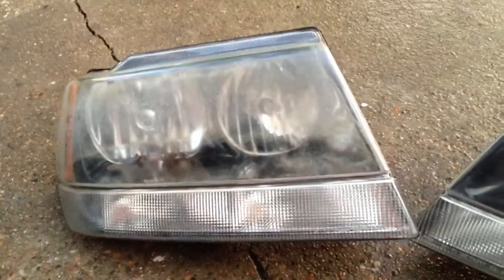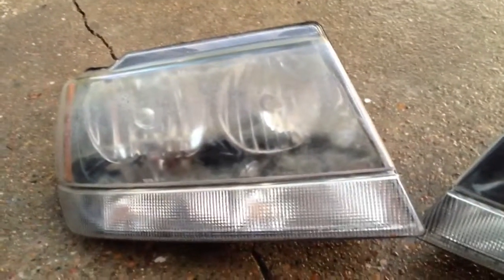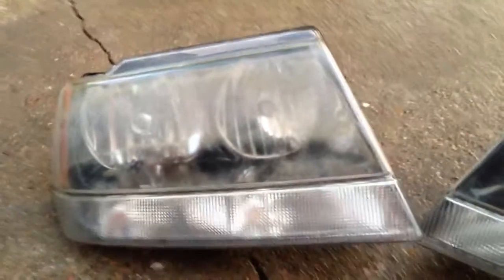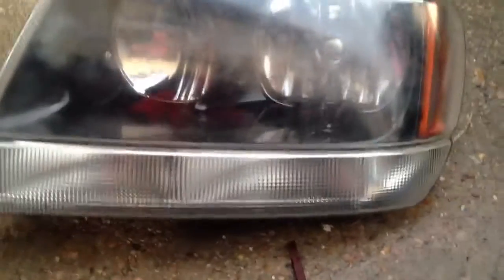I got a couple of them. A friend of mine asked me to clean these lights, and so I went down and cleaned them three or four times — they turned out bad. So I had a set here that I had taken out of another car, and I polished them up with this technique. Just stay with the sanding a bit longer than I did and you'll get all the way down to totally smooth, clear plastic. Areas like this clearly need more sanding — not much more at that — and they would come clear and you'd have a totally restored lens.